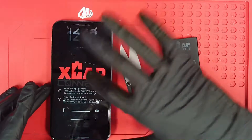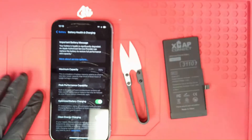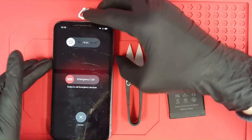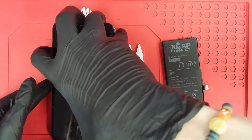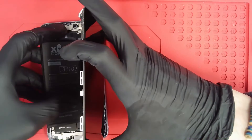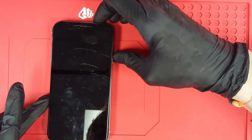With our demonstration device here, we're going to navigate into the battery health system and show you that we're at 75% health. So we'll go ahead and shut this device down so we can fix this and install a new battery. The device powered down, go ahead and disconnect our battery. First thing we want to do for prepping calibration is we want to go ahead and connect our XCAP right out of the box to our device.